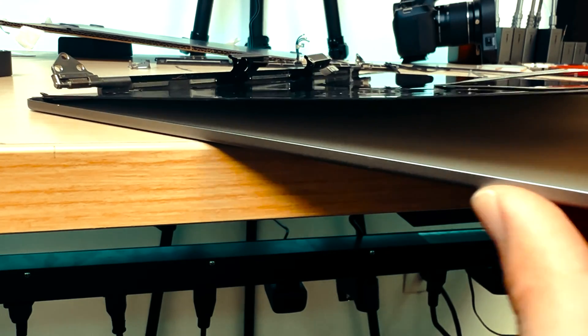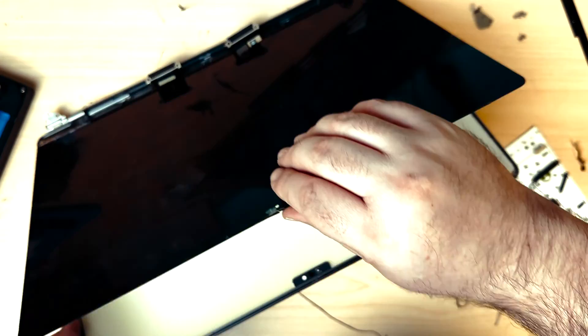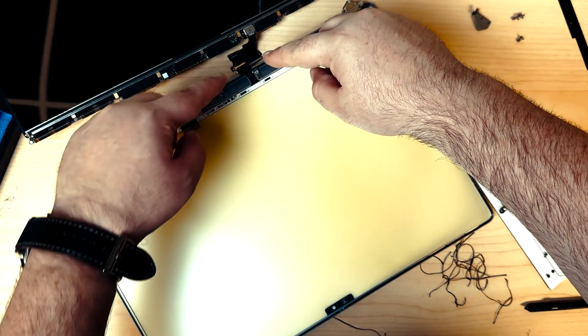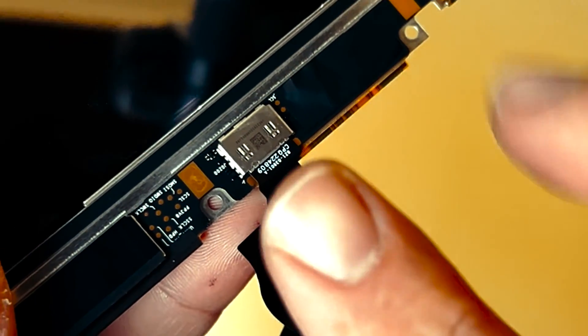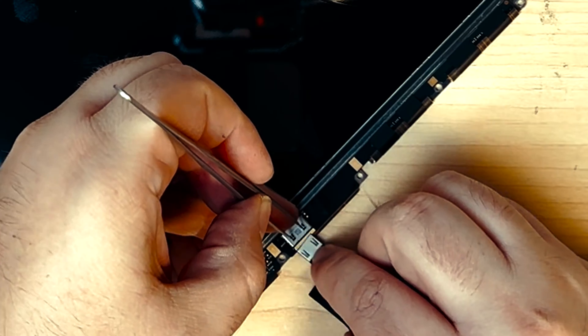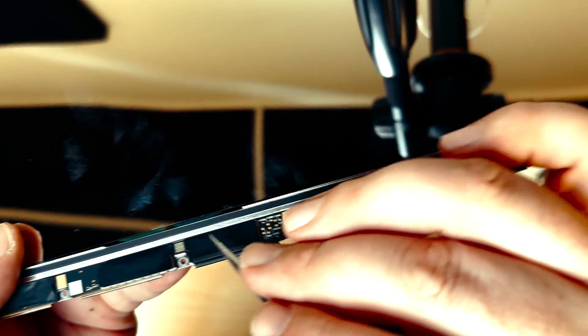And now the old panel is free. We can gently lift on the panel and carefully set it down. You need to be really careful about this flex here — this connector is a little bit unique. I'm going to add some isopropyl alcohol to the bracket to help break up the adhesive. Now we can go deal with pulling this out. There are two little prongs that stick up in there — you need to push them down to pull it out, just like that.